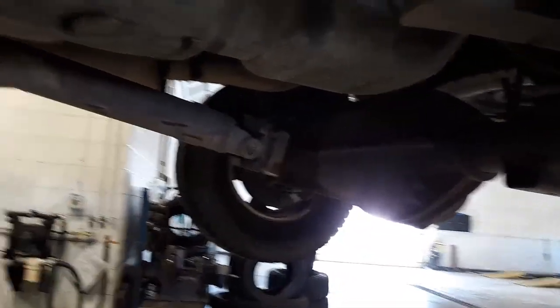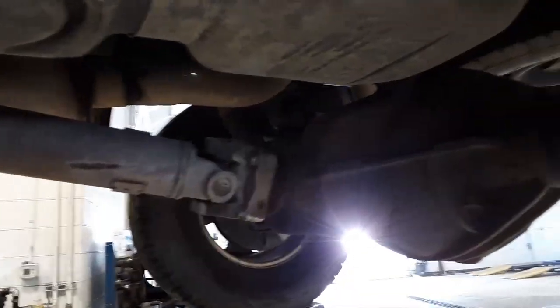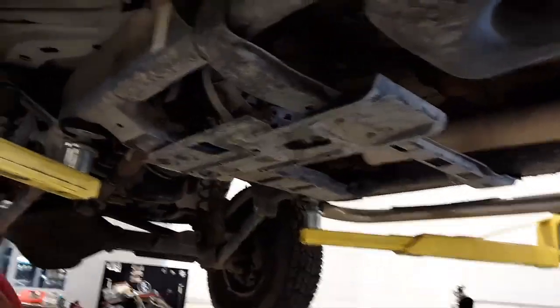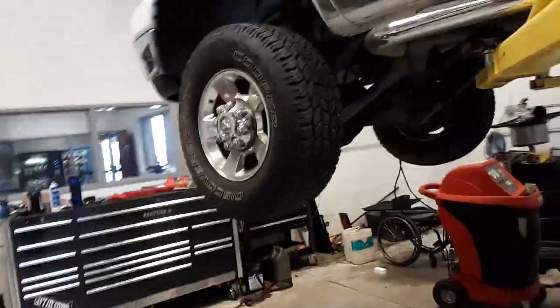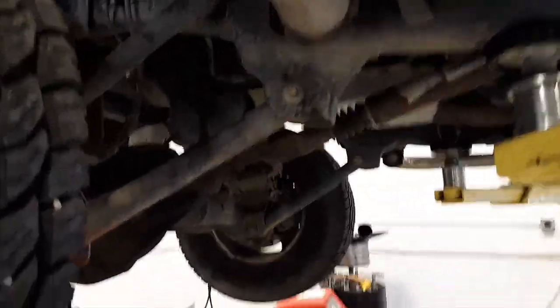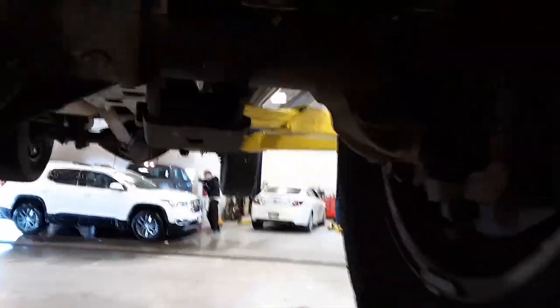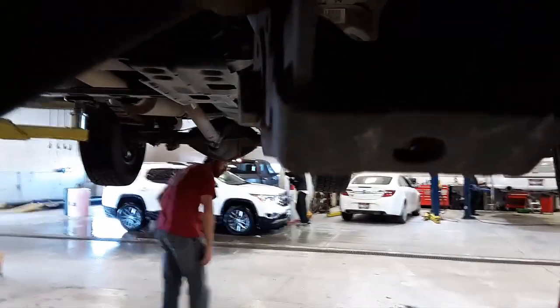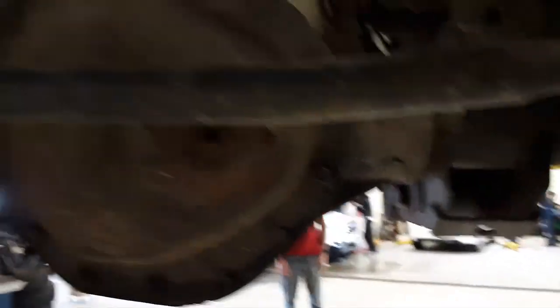While we're at it, we're checking out the differentials and the universal joints. We're changing all the oil in every spot we can — except for the transmission, since it's under warranty and should still be good. Let me show you some other things under here. See those little boots? The red ones? Those need to be replaced — you can even see this one's twisted a little bit. That needs to be replaced. That's one thing on the list.